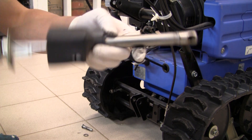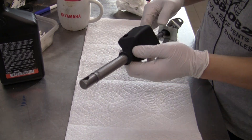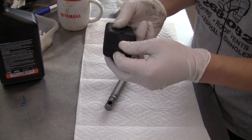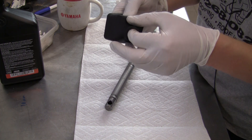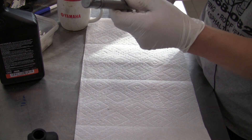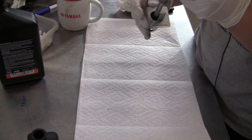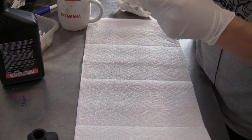Let's get it on the bench and check it out. I'll get this boot off first of all — maybe just pushing the boot from this side here. I've got a very minor tear in mine, so I might try some black tape or rubber glue to patch that up. Now what I'm going to do is take the bottom piece off so I can get this off and get this seal out. There's a seal in there that's busted.